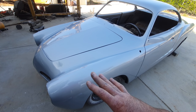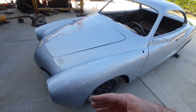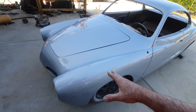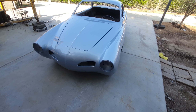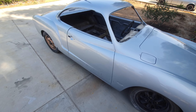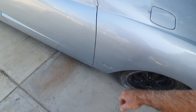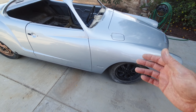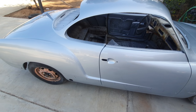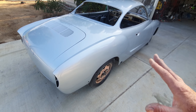This was not intended to be a show car — just a quick repaint. It got sanded down, had some body work done, fenders grafted, rust holes welded up, block sanded once, then painted. There's one spot where something fell into the clear near the end — something from the blow-up spray booth ceiling landed in the clear. I picked it out and I'll need to do a small spot repair there. When you do your own car at home, you're going to have some issues and just have to deal with them.